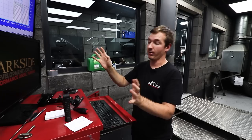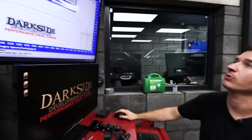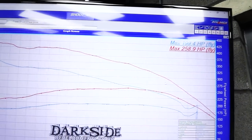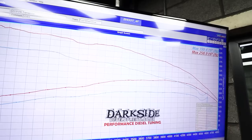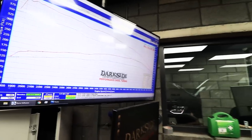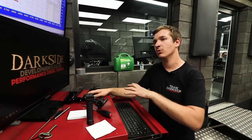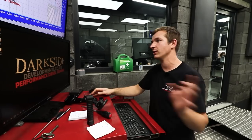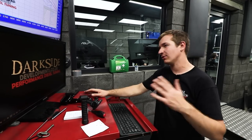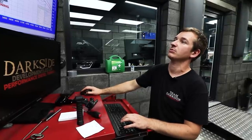They're not bad. So we'll look at the tuned horsepower — it's not pushed ridiculous. As you can see, this is what we've managed to squeeze out of it. We've just done a really long pull after this as well, and the EGTs are getting a little bit hotter than we want them to get, but still nowhere near as hot as the standard S4. But I think we're probably pushing it a little bit too far if we're keeping the emissions equipment, because if you start putting too much fuel in there you're going to get soot mass and start blocking the DPF. Between runs it's not getting blocked, but you can see an increase in the soot level — it's not going to regen, it's not really doing any passive regen either, so that's to be expected.